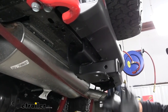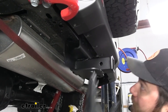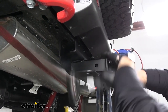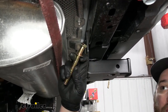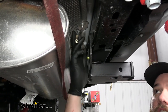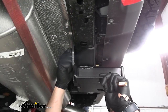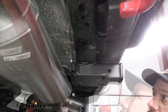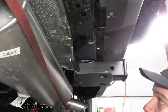If you're having trouble sliding it up into place, you can usually take a soft blow hammer. This is going to be a really tight fit, which is nice, but we can just pop it up into place. Now we can take our hardware that comes included in our kit. We'll start with a flat washer and our long bolt, and slide it into the hitch holes. We have to work it around a little bit to get it to line up with all the holes. Since we had these two factory weld nuts and the factory bolts, we're only going to need to use two of the flange nuts, but we can install one on each of our bolts.